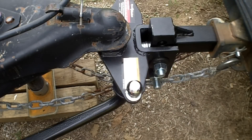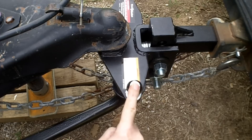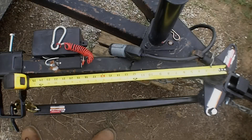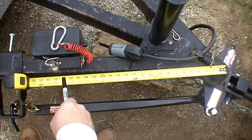Well I've got the ball installed — step one complete. If you don't have one of these weight distributing hitches with a hole for one of these balls, then you will have to have that metal plate welded on so you can mount it. I also wanted to mention that this single installation is rated up to 6,000 pounds gross trailer weight. If you have between 6,000 and 10,000 pounds, you need to install two of them, one on each side. You can mount this on the left side or the right side of the trailer. The next step would be to measure from the center of the coupler straight back to 24 inches and make a mark.